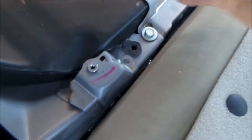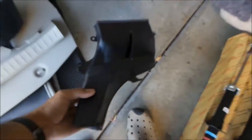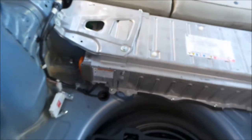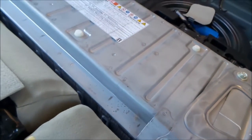Let's take out the pliers now. You need to take this — it looks like a relay of some sort. All you do is get some pliers, squeeze on this, and it comes right out. Take out your cooling duct here and make sure you clean that out really good — the life of your battery depends on that. And rejoice — I see the shock absorbers! So these got to come out. I don't know if we have to take the seat backs out. I think we might be able to get away with it — you can probably just go here and here. They look like they're in the way too, so go ahead and take the seat backs out. Go ahead and take these four bolts out — 14 millimeters, fairly meaty bolts.